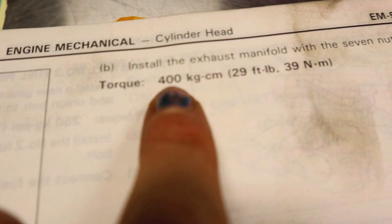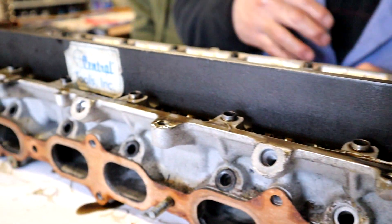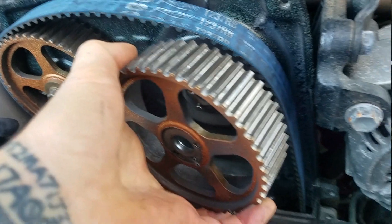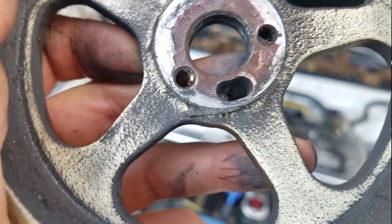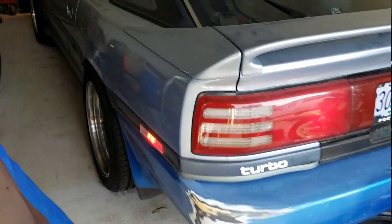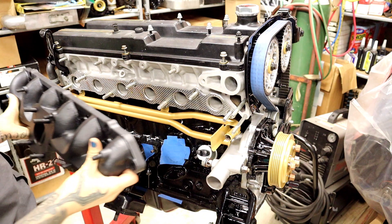The torque spec wasn't that high — it was like 29 foot-pounds — so clearly something had gone wrong. I'm someone who's super by-the-book about torque specifications, so I don't think I had over-torqued them previously. What had actually happened relates to why the entire Supra Saga series started: my warped cylinder head. There had been a time where everything overheated so much due to improper timing that my turbo was glowing cherry red. I think the expansion had pulled the studs out and stripped them. So I went ahead and helicoiled every single stud, and then finally got to install my exhaust manifold.